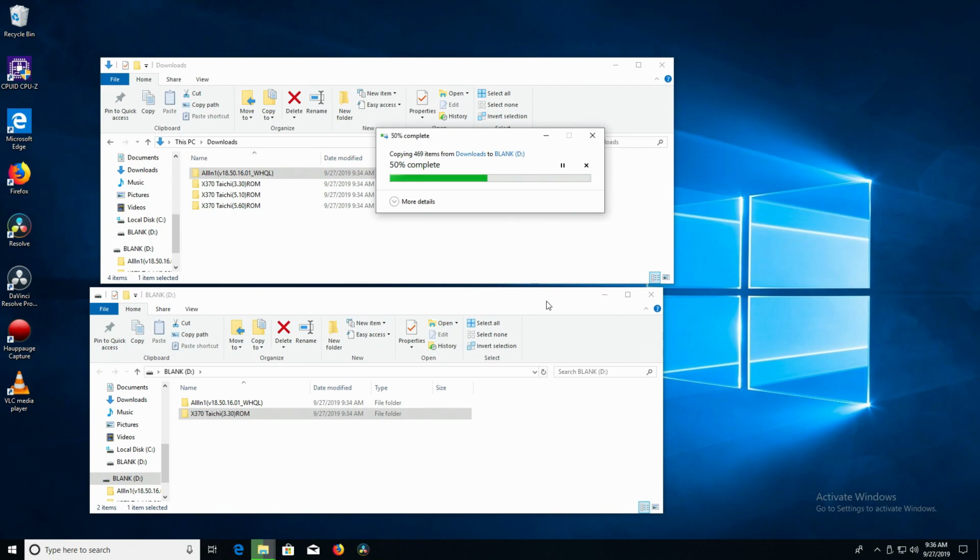So we'll see how that works. Anyway, if you have more than one BIOS file on there, you can select the correct BIOS file, but because this is such a convoluted and complicated update, I want to make sure that I only have one BIOS file and I don't mistake which one I'm going to install, because I don't want to brick that motherboard. It's still a good motherboard.